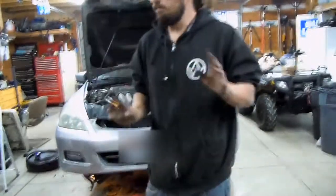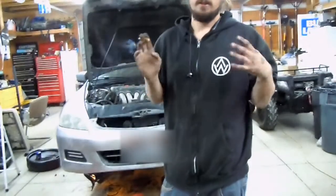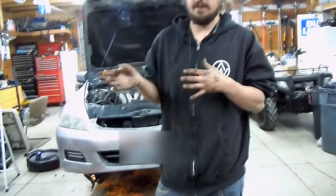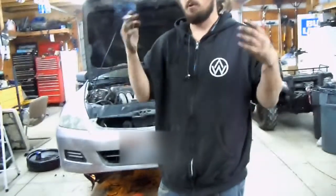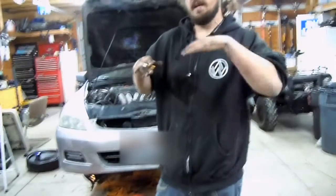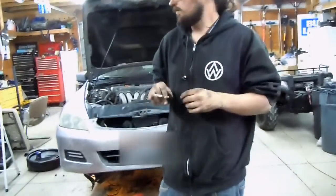Alright, so I got the oil pan in, sealing on. Could not show you guys the process of getting it in. Same process as getting it out. You have to pry on the subframe, get down, and you may have to jack up the engine a little bit more so you get enough clearance to slide down and out.